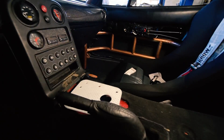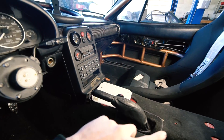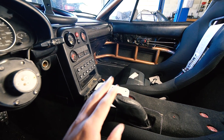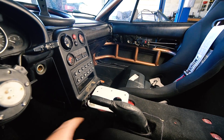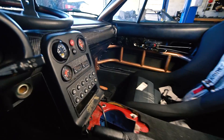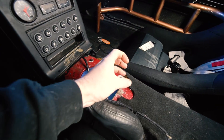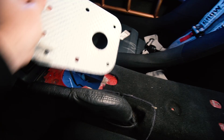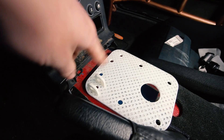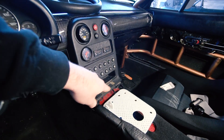So I wanted to keep my stock handbrake, which is kind of funny because now I have aftermarket rear calipers and I can't use it anyway. But the whole point is to make a clean handbrake setup, retain the stock handbrake, and not have anything in my way over here. So this is what I came up with. We've got this giant hole which we had to enlarge for the shifter, the new shifter location. So this plate covers the old hole, has a hole for the shifter now, and then has these tabs on it right here, which would be welded on, and then a handle coming up — that'd be the handbrake handle.